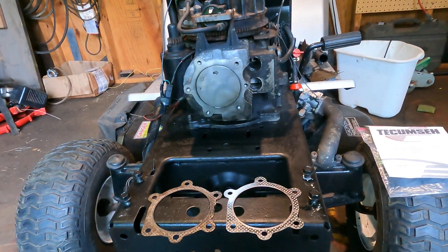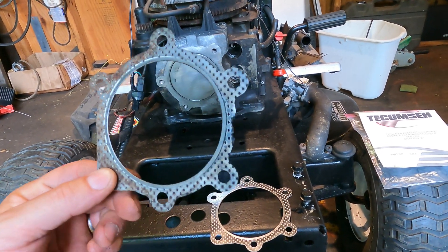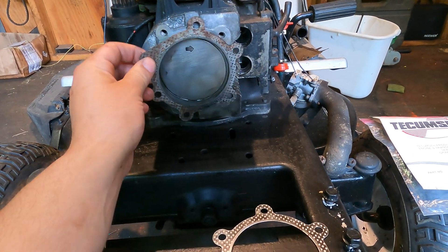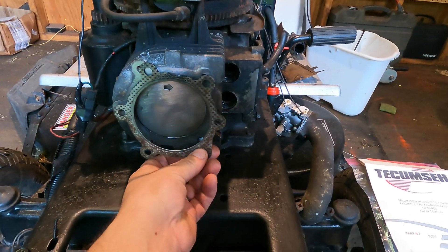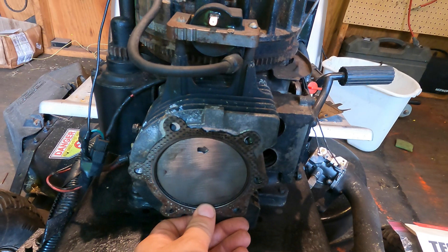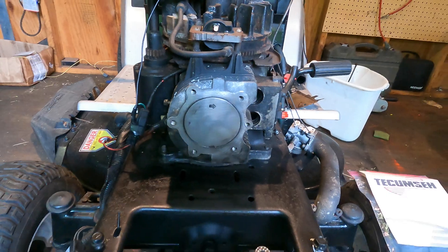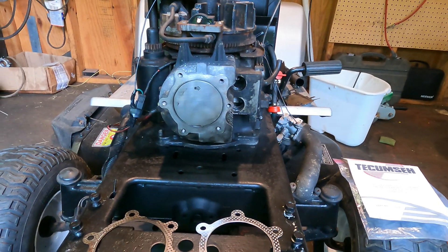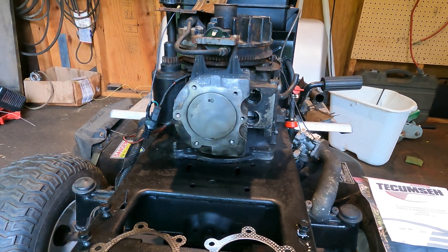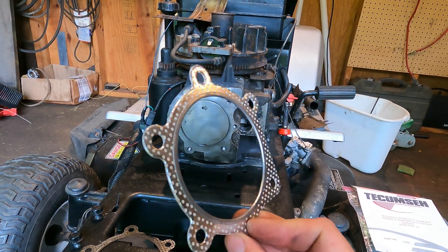I will try to show you that as I reinstall the head — that's part of the reason I'm making this video. So here's the old head gasket. It's not too bad, but it's damaged at the top, which I don't know if that would cause the leaking. I'm hoping this is it. Obviously it could have just been loose head bolts and things like that, but since we're in here, we're just going to hope that it solves it. So there's the new one — part looks correct.